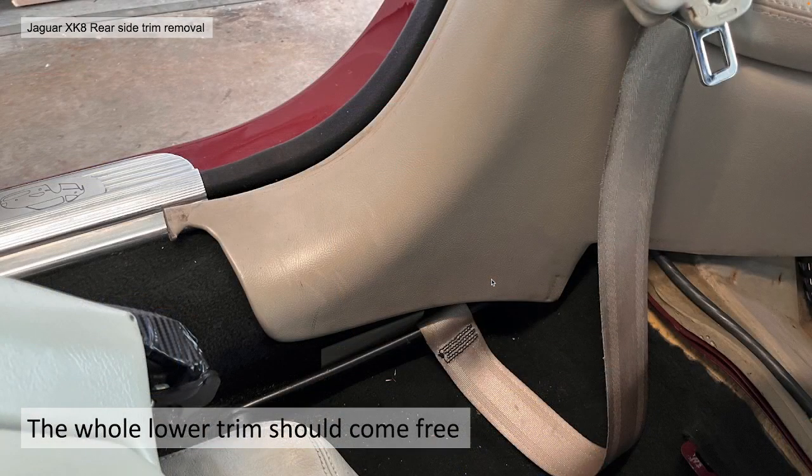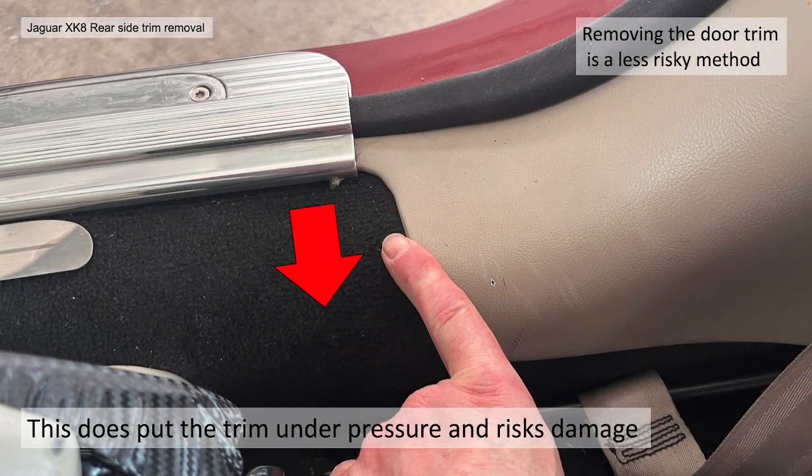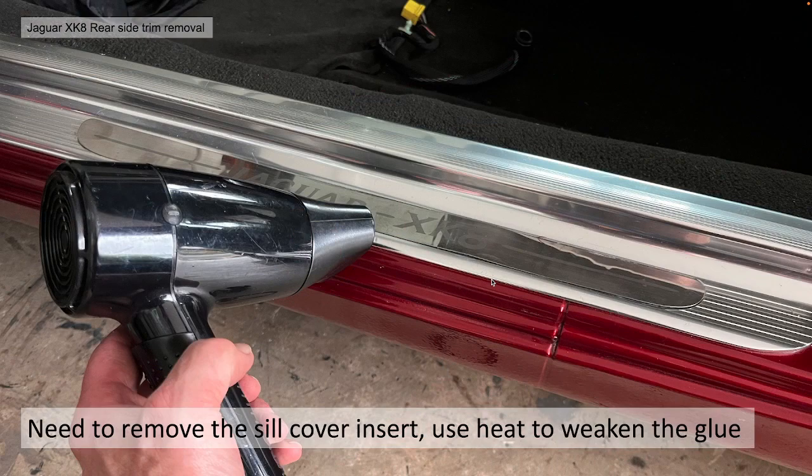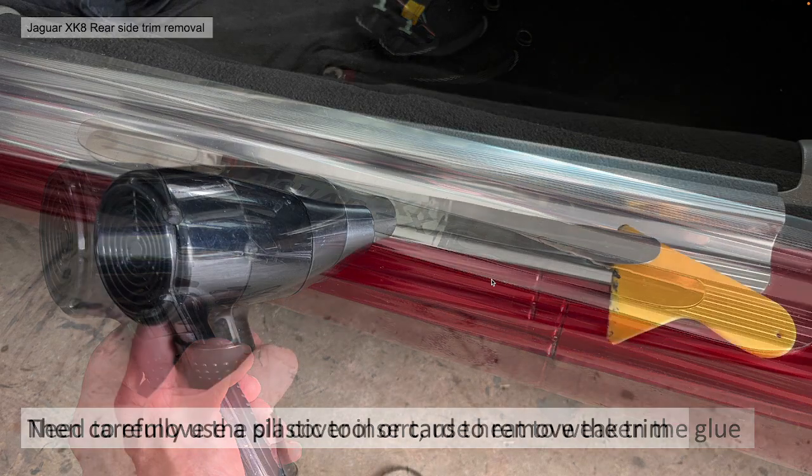The whole lower trim should now be free. What I would recommend is actually releasing that sill trim and pulling it inwards into the car rather than trying to push it rearwards. Removing the door trim itself is a less risky method, albeit it has its own issues. If you do want to do that method, you need to remove the sill cover insert. It's glued in with some heat sensitive glue,